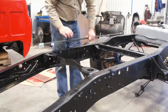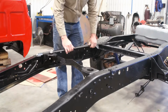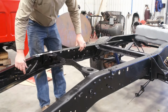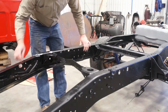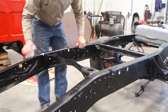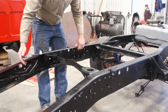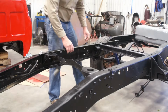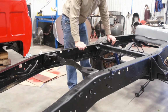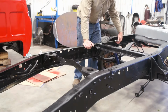Now my suction and return lines are 3/8 and 1/4 inch respectively. What I'm going to do is snip them off right here at this last bend, and we will put a flare fitting connector in there. These are the longest tubes that my parts house had in stock. They are 60 inches, 5 foot. So they're going to get me about here at the shock absorber at the back.